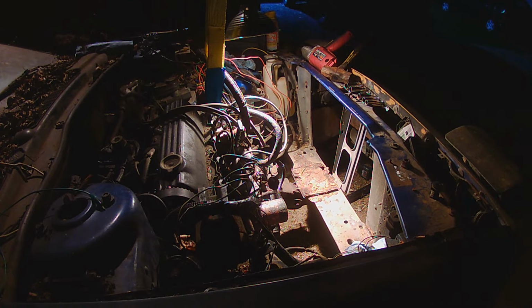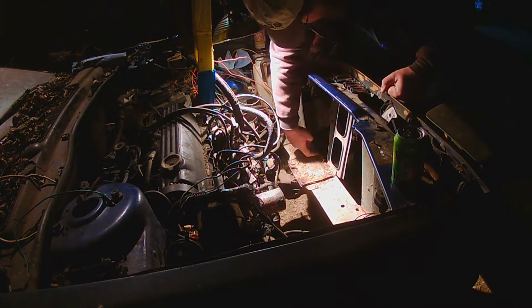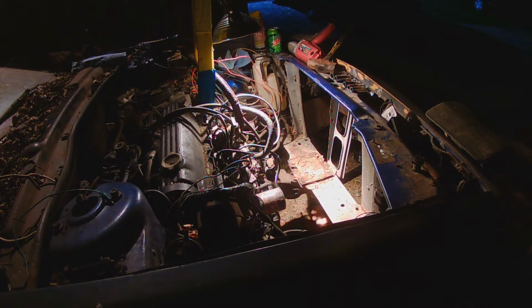We'll watch. Okay, there I am on the passenger side nut. I took the two nuts off first and then the bolt that's forward of that and lower because I wanted to make sure that my arm was out of the way if it decided to slip off the jack and fall anyway. Because stuff does stupid stuff like that. Even though I've got it supported, you can see in the top center of the picture I've got that lifting sling attached to that hook that I just bolted straight to the side of the motor. That's not really safety-wise, but I figure with that plus the jack holding up the mount.